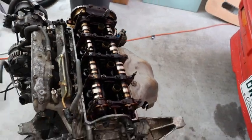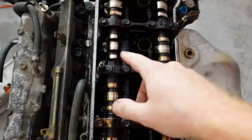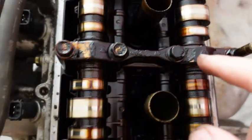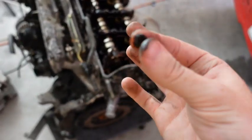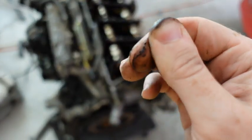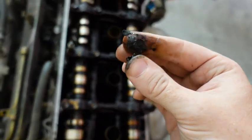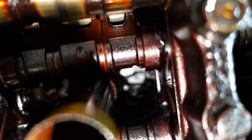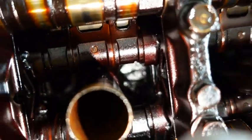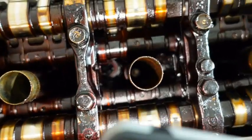And this is what we purchased. Oh god, you can already see it. On the initial glance you guys can see just how dark this is. The cams don't look terrible, but when you start to look at how dark and deep everything else is, you start to realize that there is a lot of sludge in this engine. When we look at the actual sludge, you can see that there's no metal in it, but it is solidified oil. Sludge builds up over time from not doing regular oil changes — upwards of 30,000 to 40,000 miles. You can see all the parts are just coated in a dark purple, and just how much sludge is in here.